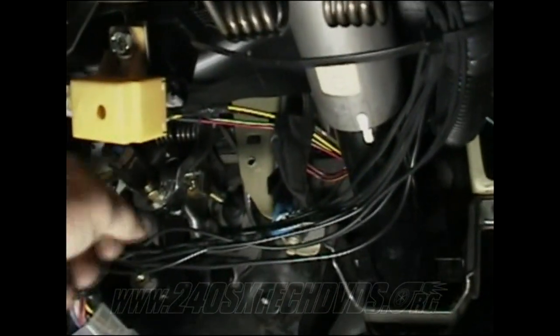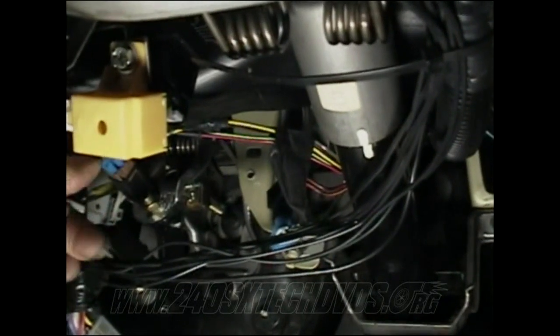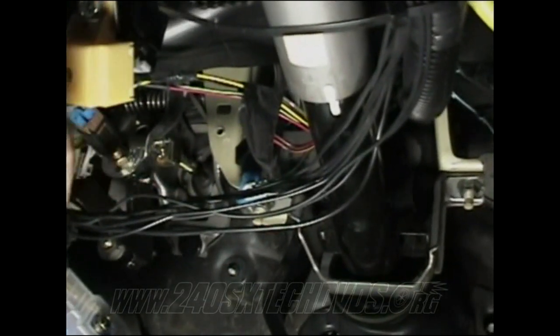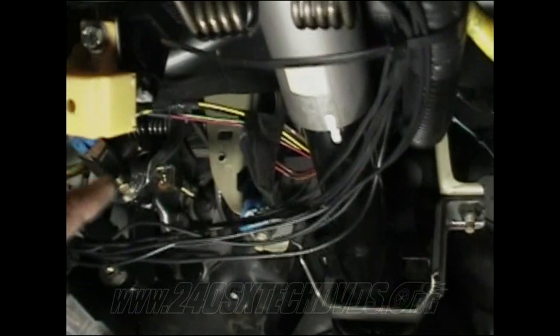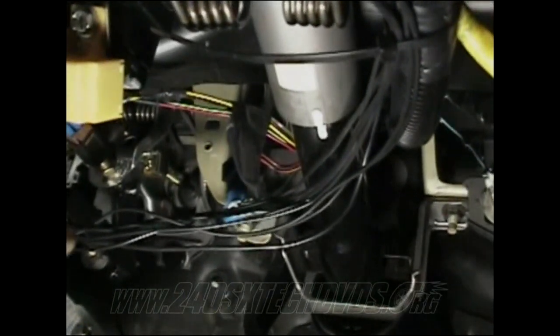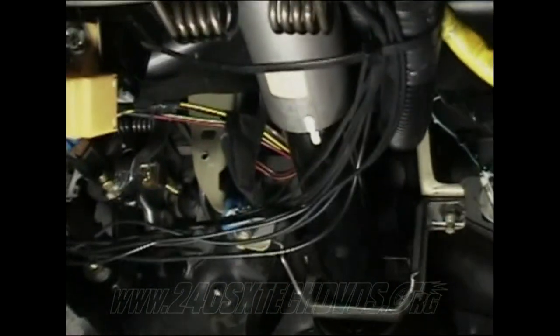And also adjust all your sensors to where the pedal comes fully down and pushes the button in all the way on the clutch and the brake pedal, and then tighten everything down. You have two nuts on the outside of the firewall for the clutch master cylinder, whereas the brake had the four on the inside. And you also have the bolt up top that bolts to the dashboard that you need to tighten up. Basically what I did is I put the pedal in, started the bolt up top of the dash to hold it there, and then brought the master cylinder in and adjusted it to where it needed to be with the screw there, and kept pulling it out till I got it right and tightened all that down.